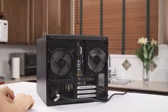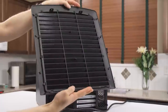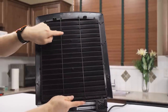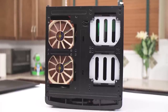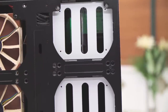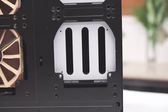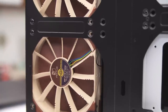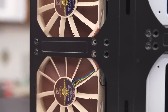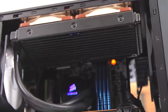The top cover slides off with a couple of thumbscrews at the back, revealing some unfortunately difficult — basically impossible to remove — noise dampening foam, as well as dual fan mounts on each side. On the right is a dual 120/140 millimeter fan mount that will work with a 240 or 280 millimeter radiator if you remove the hard drive cages first. On the left is also a dual 120/140 millimeter fan mount, but due to clearance constraints with motherboard cooling and memory, it supports only a 240 millimeter radiator.